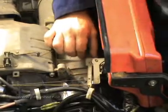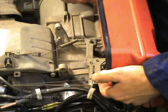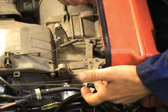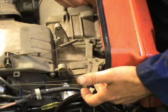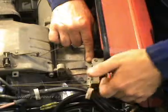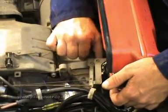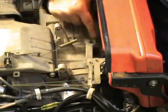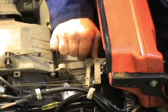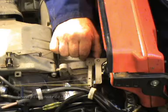This is slightly complicated by the fact that the machine has auto throttle. What auto throttle does is when there's no load on the machine, it shuts down the carburetor into tick-over mode. In order for that to happen it has to have this pivot in the middle of the governor arm. If you haven't got auto throttle you won't have that pivot — it'll just be a straight arm. But because we have got that pivot, when you're setting the governor you've got to hold it locked solid while you're doing it.